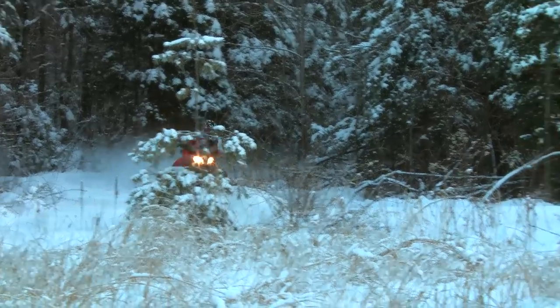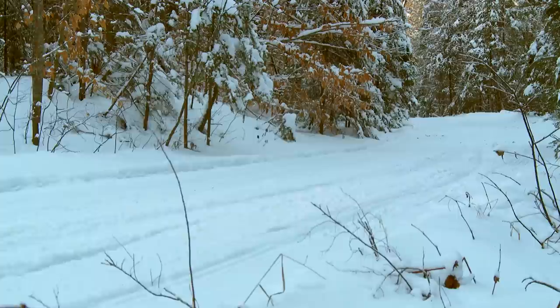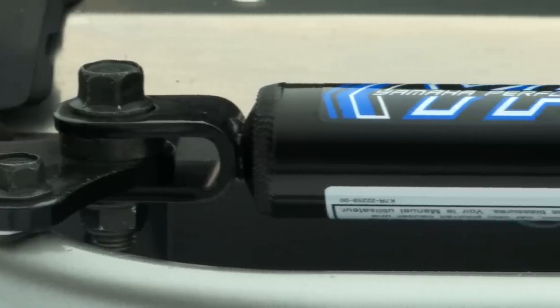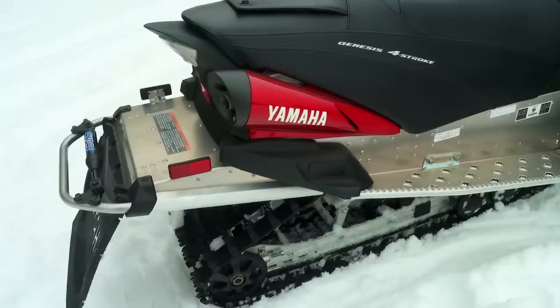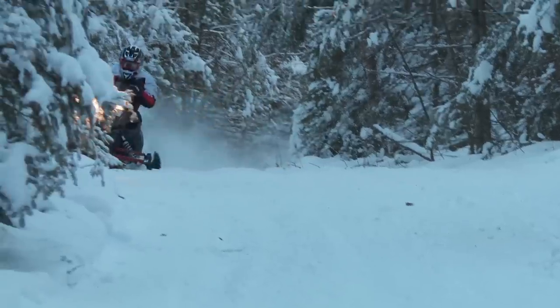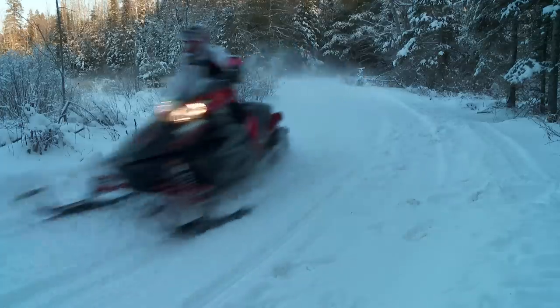I'm not saying it takes all this stuff away, but it does make it better. The whole idea that a snowmobile might be flexing has twisted my understanding of what the Performance Damper actually does. When Chris explained that all vehicles produce resonance, including bridges and buildings, the idea finally sunk in. This inherent frequency of vibration is not a flex problem — it's a reality with anything that moves.